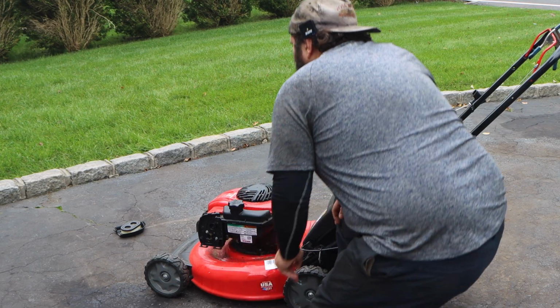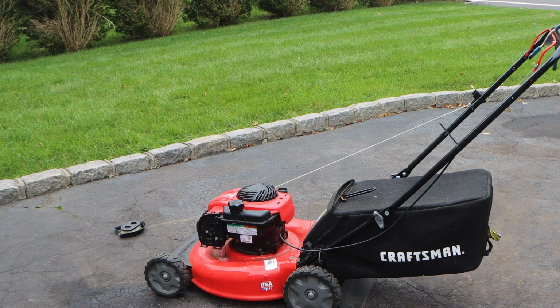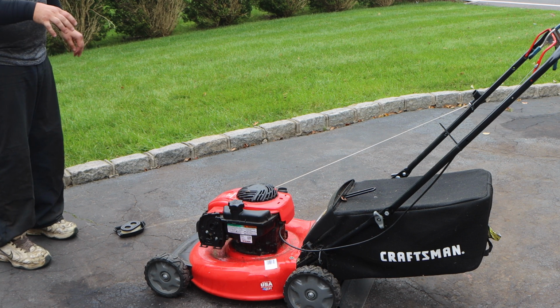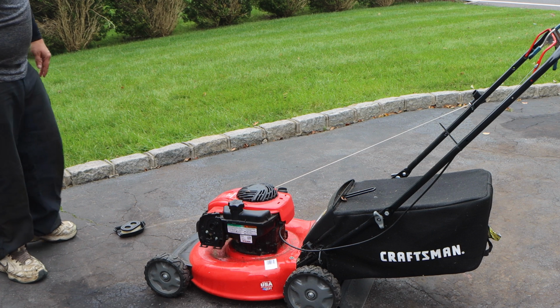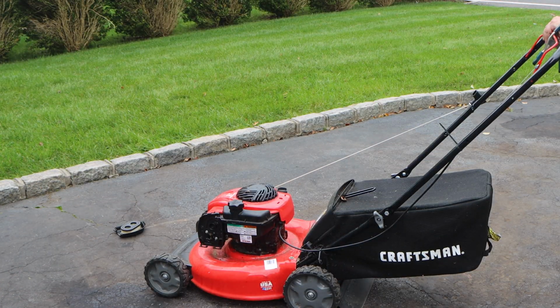Okay, so what I was trying to do is, as I'm squirting fuel into the combustion chamber, it is igniting. And sometimes we have seen that we can keep the motor running and seafoam will knock whatever's loose and blocking up the jet, and let it go through. Obviously there's something in here that's jammed in there pretty good. Let's try it one more time before we try and get physical.